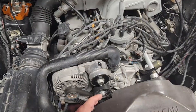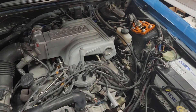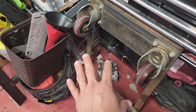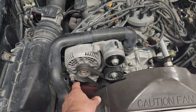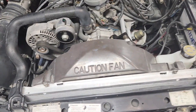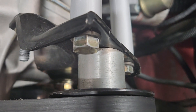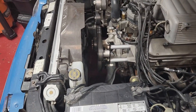A couple things — I tried putting this belt on and it was too short. I remembered that the 8.9 actually has underdrive pulleys, so the belt was not quite what we needed. So I went out and got the original alternator, removed the pulley off of it — that's the pulley that was on Frankie — and moved this pulley to here. That wound up allowing the belt I already had to be long enough. That's the part number right there, though you'd have to have yours in the exact same position as mine. It rides very well.